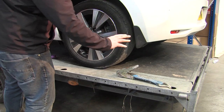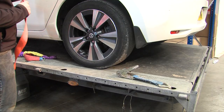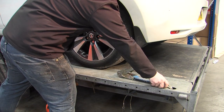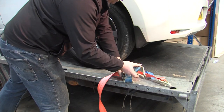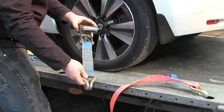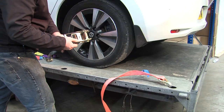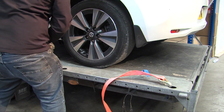When strapping the trailer, lay your ratchet strap out onto the trailer with the ratchet hooked in, or your strap hooked in. It's always good to have the ratchet as far as you can from the wheel — again for the same reason that you use car transporter straps.